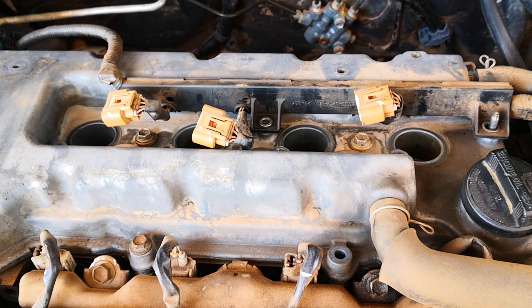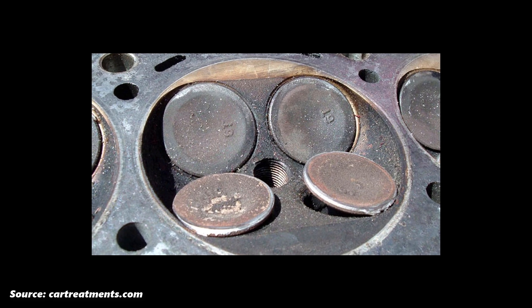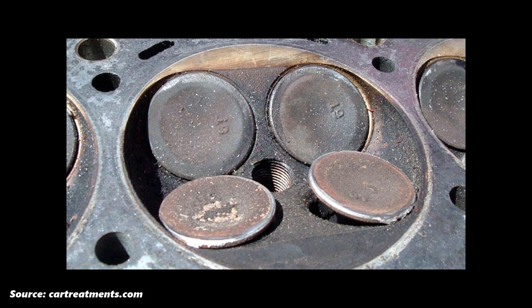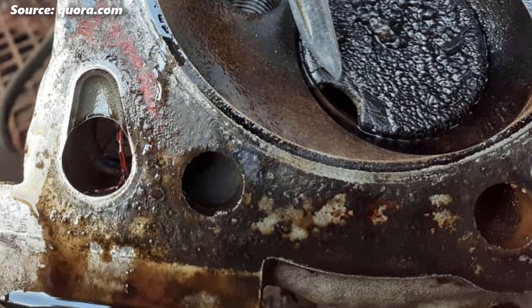Through an inspection like this, you can also identify the state of the exhaust valves, especially if they are closed. Moving over to cylinder 2 where the intake valves are open, you can see that the exhaust valves are fully closed and well lapped to the valve seat. If the valve were bent, you'd observe that the valve head sits at an angle and there may be a gap on one side. For a burnt exhaust valve, you may be able to see that part of the edge of the valve head is missing.